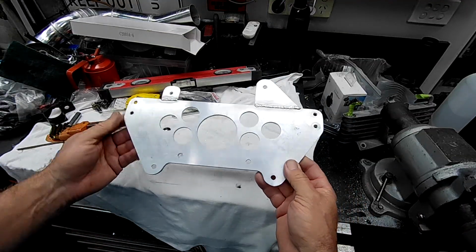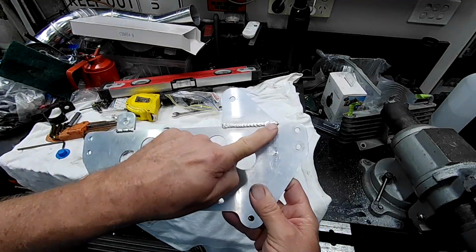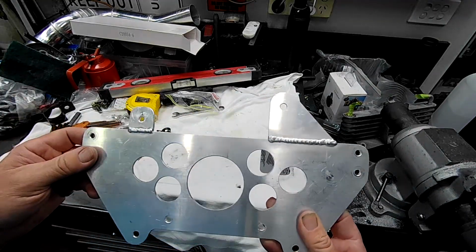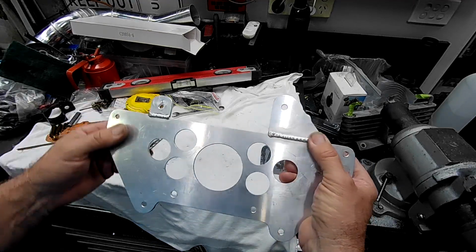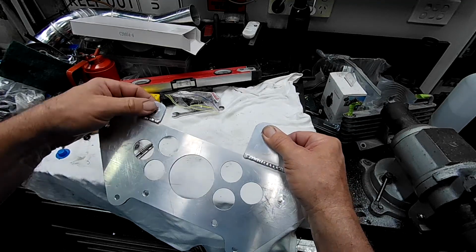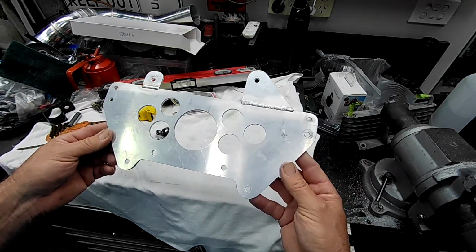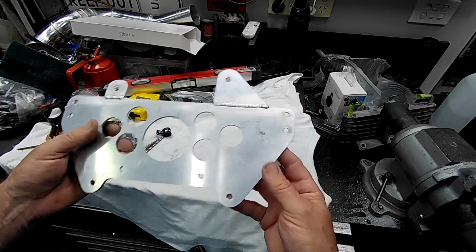Alright folks, we're just about there. This is our engine oil cooler mount, and these are a couple of tabs that I've welded on to take various things for the power steering cooler, the mount one end, and this is actually to take a P-clip to hold one of the lines that runs up to it. So I'll get this bolted back on and we'll have a bit of a look at it, eh?